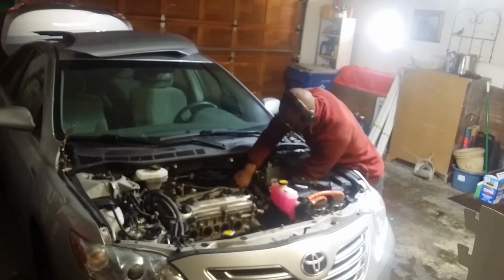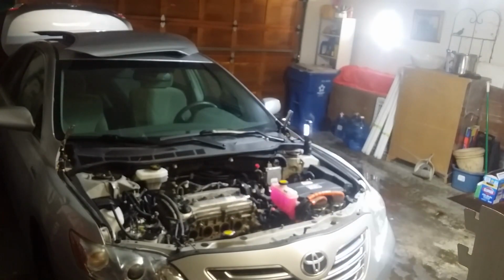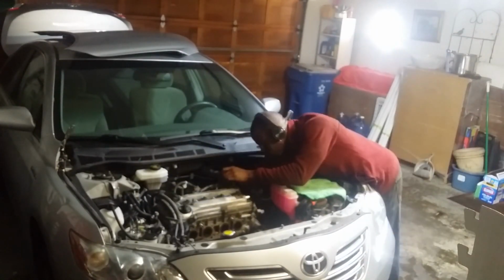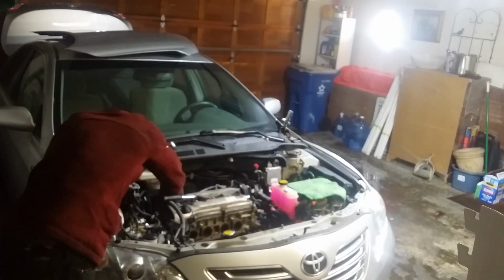If I were to do this again, it would of course take me about half the time it took me here, but more specifically, I'd first pull the exhaust manifold, then unbolt the mounts on the top and the bottom so that the engine could roll forward.